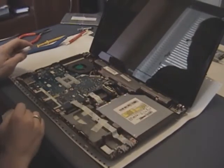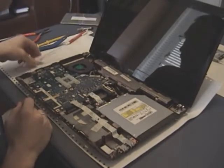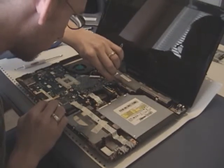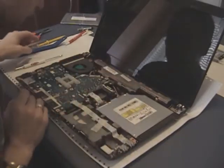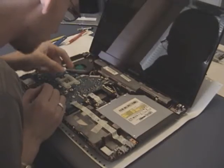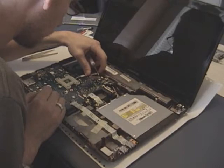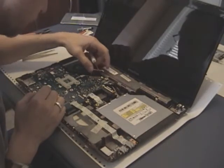There's also a cable coming up to the top right of the motherboard — go ahead and pull that one out. And there's also a ribbon cable here that's got a white bracket on it. In this case the white bracket is actually part of the ribbon cable, so go ahead and pull that out.